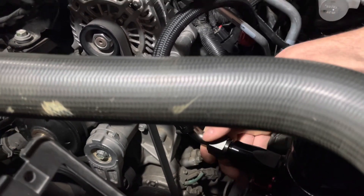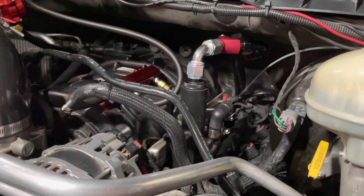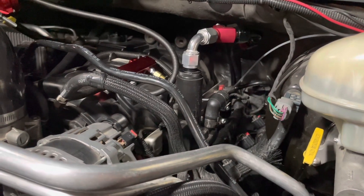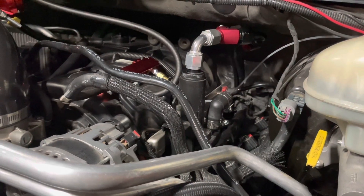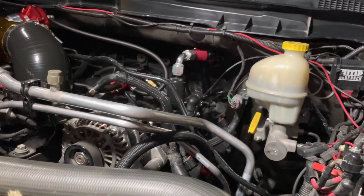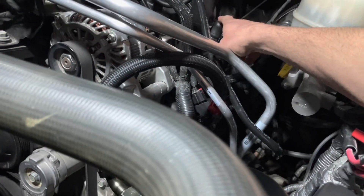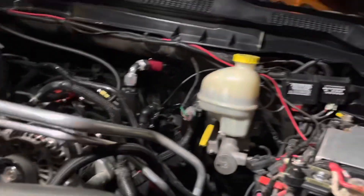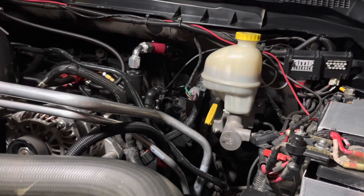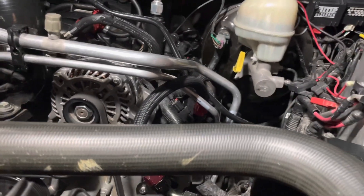What this is going to do for me: I had oil shooting into a place where you'd normally vent crankcase pressure, so I was pushing pressure into the motor. With the turbo and all the blow-by, there's a lot of ridiculous pressure going on, so this was absolutely necessary. While the truck is just cruising or idling, I won't have an issue. But I did have a catch can hooked up and everything seemed fine until I did a good wide-open throttle pull — then oil started shooting right out. That's my indication I had a problem.